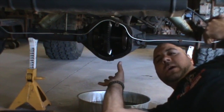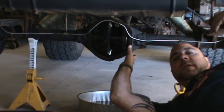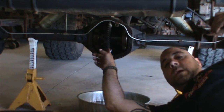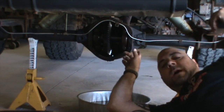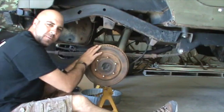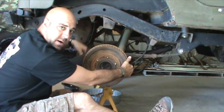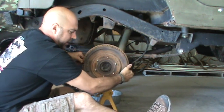So we've got the wheels and tires removed. We've got the rear diff cover taken off. We're letting the fluid drain now. Since we're going to be reusing this same ring gear, at this point we don't need to remove the driveline and we shouldn't have to remove the pinion gear. We're going to take these drums off on both sides. This one's coming off pretty good — sometimes you need to use a rubber mallet to help it along.